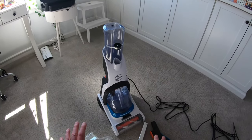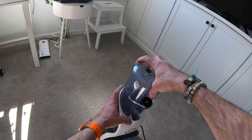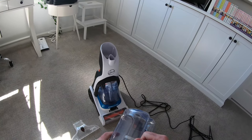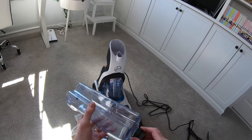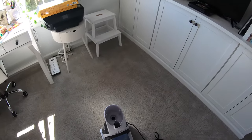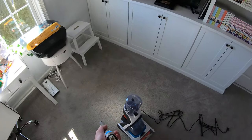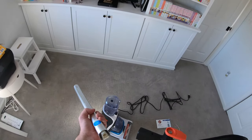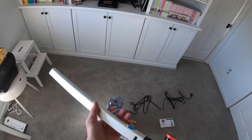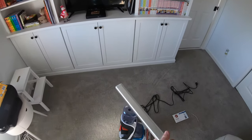In this video I'm quickly going to show you how to assemble the Hoover Powerdash Carpet Cleaner. The first thing I'm going to do is remove this water bottle because I need to take this piece of tape off in order to first screw this little part onto the bottom — this is where we're going to put the water in. You then need to do that in order for this part to lock down. Take this handle — you see the two little prongs on the side — that's going to snap down into there like that, and this is the top half of the cable tidy.